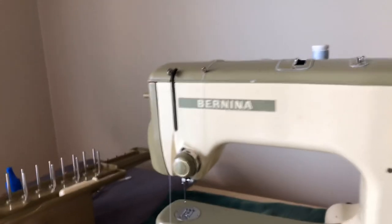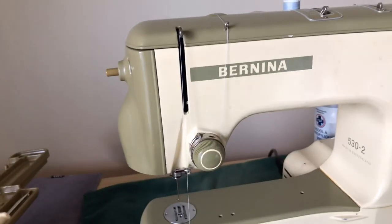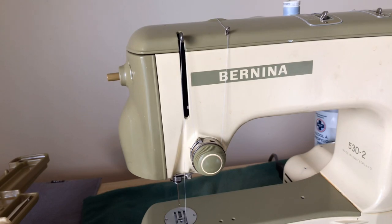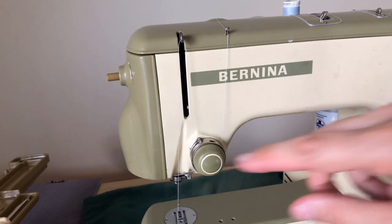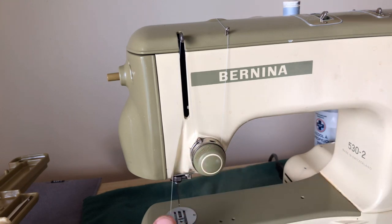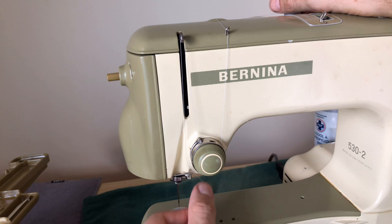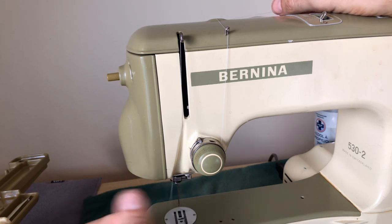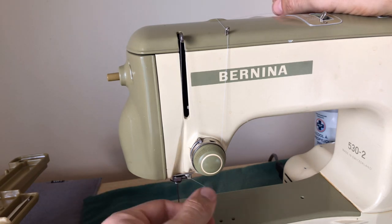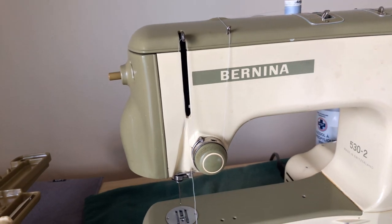You can't see the check spring in this because some designs of upper thread tension assemblies have the spring out, but in this case it's recessed in here — it is in there. If you cannot tell it's in there, you'll find out very quickly. So the thread guides... let's zoom in so you can see a little more clearly what I'm doing.